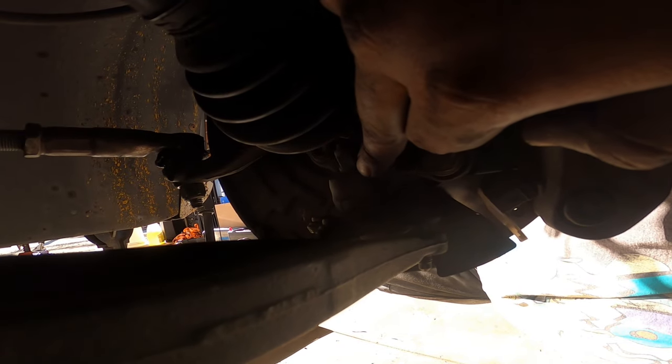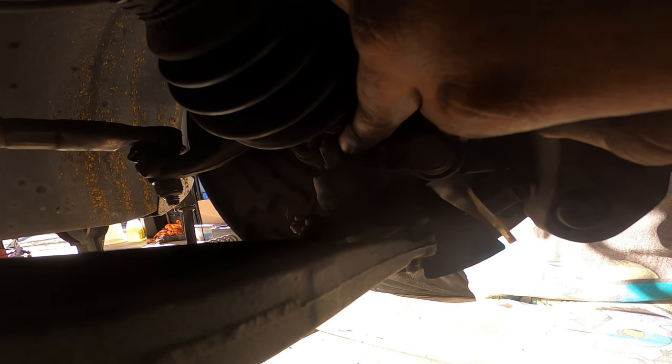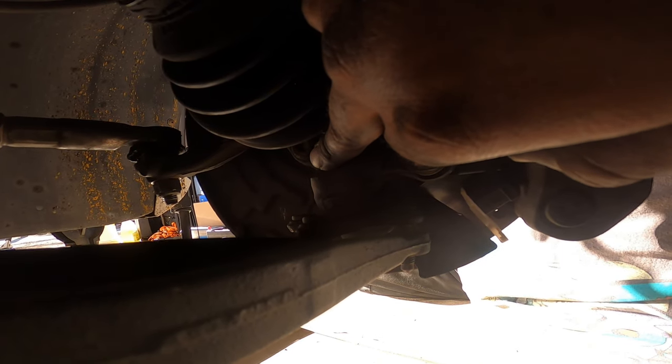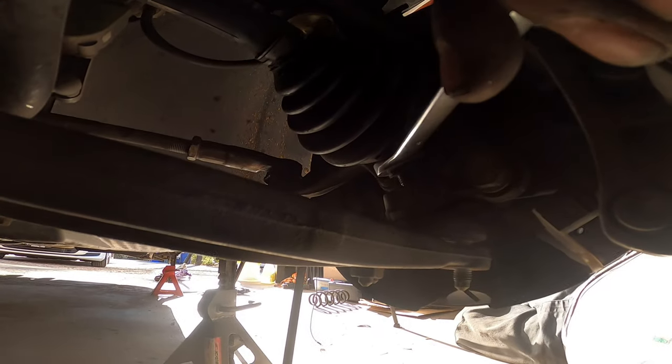If this is an original or OEM-style ball joint, you should have more than a thread for the nut to hit the axle. What we have to do is unbolt the ball joint until it hits the axle. As you can see here, I've unbolted the nut from the ball joint and now it's hitting the axle right here. The pressure from the bolt hitting the axle should in theory pop the ball joint.